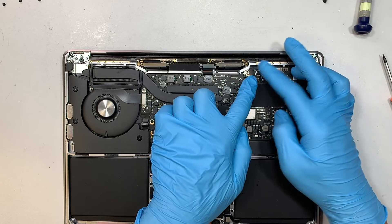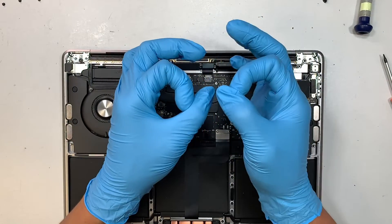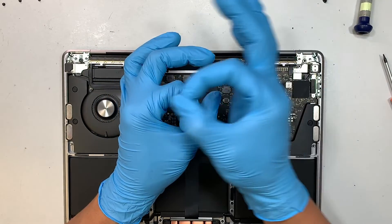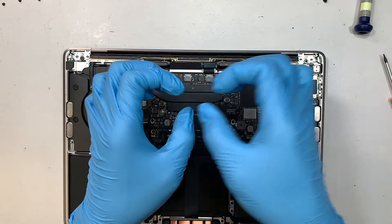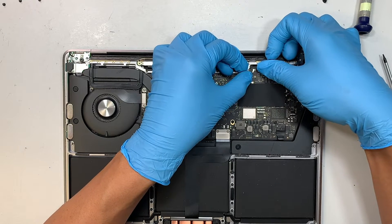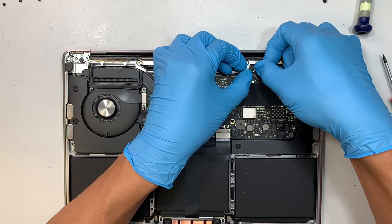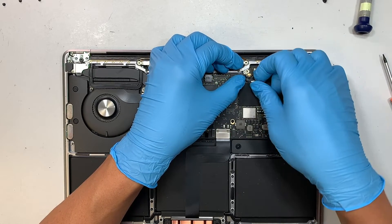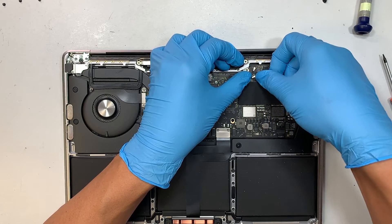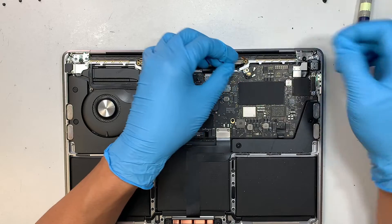Align the Wi-Fi connector and put it back in. Think of it like Lego — the circle on the board is smaller and the connector is bigger, so align them on top of each other and press it down gently. The critical step is aligning those circles. Apply a little pressure and the connector will go back in. Do not force it hard or you will damage that circle.